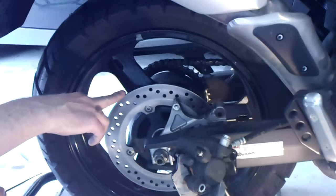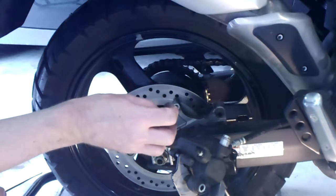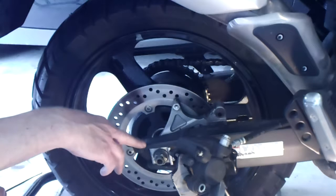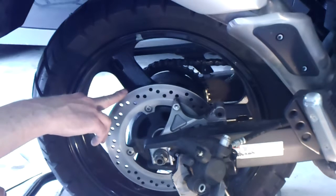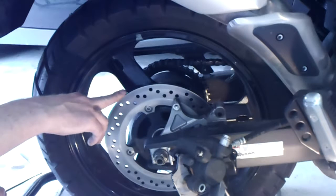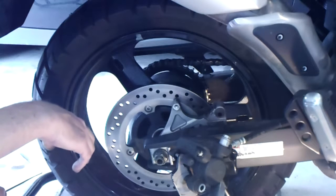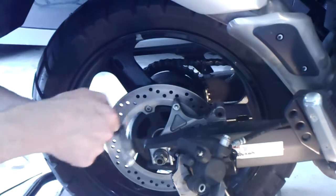That failure can come from just having a disc that's too thin, wearing down the pads on another set and just ignoring it. If you're diligent and aware of your brake pad thickness, in theory you can go below the manufacturer's recommended thickness on your disc — but why not play it safe? The way to do this is to measure it.